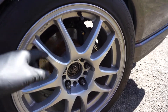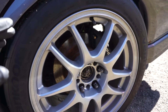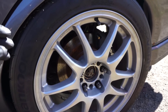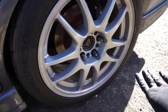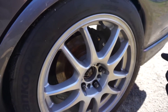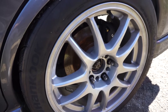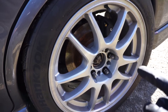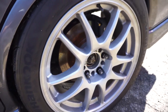The bracket is done, the specs are done on it. I'm just getting a quote for the bracket itself. For the kit, I'm actually gonna be including the backing plate — in my other video I said you would have to cut out and die grind it, but to make things a lot simpler I'm just gonna get a bunch of OEM backing plates and have them laser cut. Then I will bolt on the backing plate to the bracket. So all you guys have to do is press out your hub, take your old brake assembly off the four bolts that hold it on to the trailing arm, bolt this one on, and press back in your hub. Once I get the quote I'm working on a site so you guys have direct access to it.